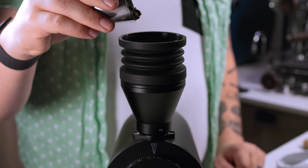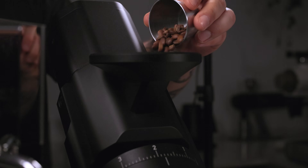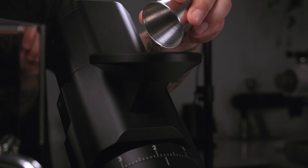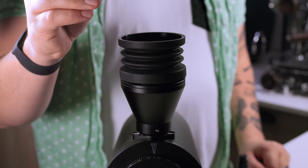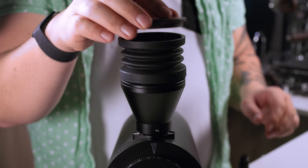Slow feeding. What I need you to imagine are the beans being fed into the burrs themselves. Unless there's some sort of auger mechanism, they're all going to be hit into that pre-breaker area almost simultaneously. Obviously the burrs can only absorb so many of those beans at once. But the pre-breakers on those burrs are so much more efficient than the rest of the burr that almost all those beans are being chopped up pretty immediately, and then they're kind of hitting a traffic jam as they're trying to exit the burrs.